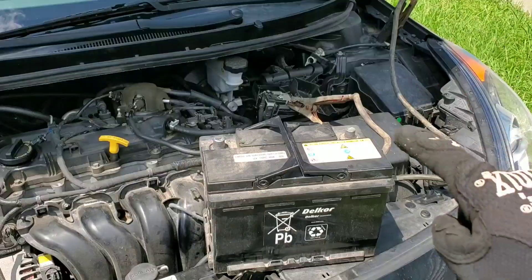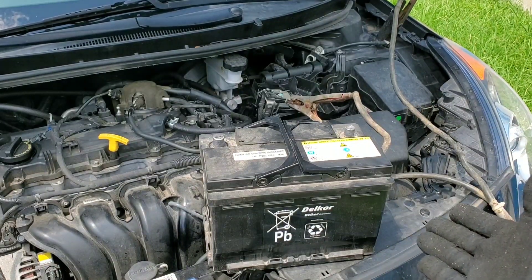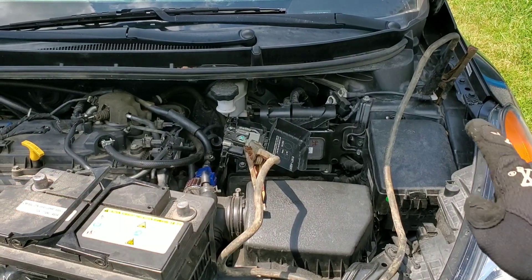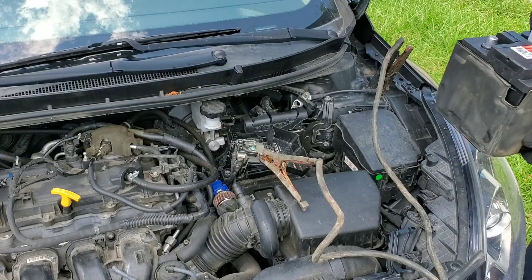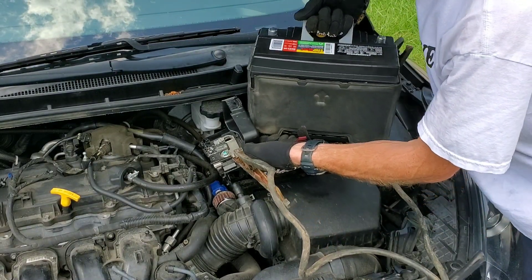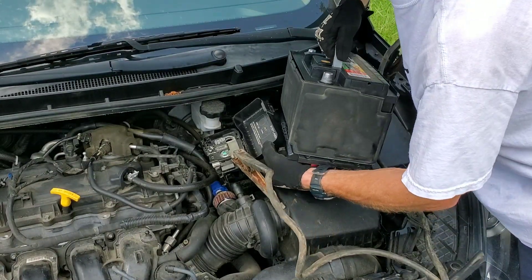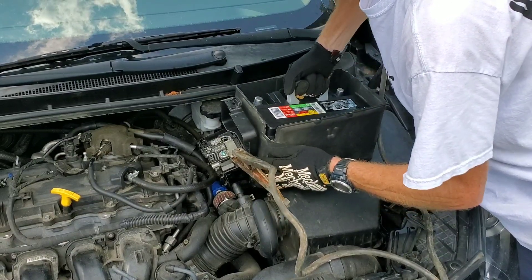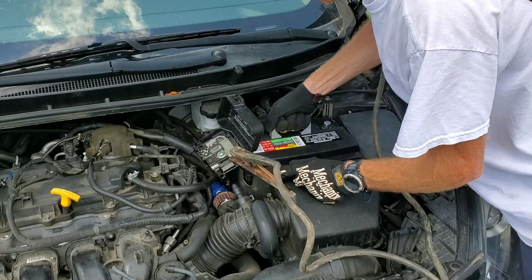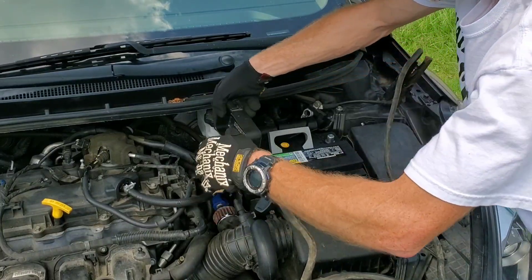This method probably won't cost you a dime. But make sure you don't touch the jumper cables together or touch a ground during this process. You'll start off by hooking up the positive to the positive battery outside of the vehicle, then the negative to the negative outside of the vehicle. Make sure your other clamps are not touching while you're doing this. Then hook it up positive to the positive battery terminal, then the negative to the negative terminal on your vehicle in that exact order. Also follow any manufacturer recommendations before proceeding.